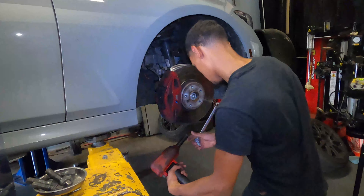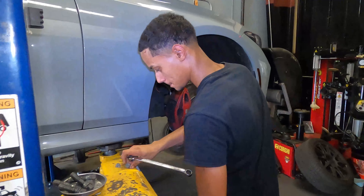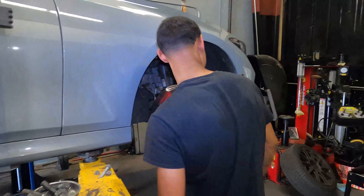Now we're going to the front — a little more complicated because it's all-wheel drive. First thing: sway bar link, 16 millimeter, snap it out. Second thing to take off is the one on the shock — 16 on one side, 18 on the other. Once you've got that loose, this little bracket here is going to come out.